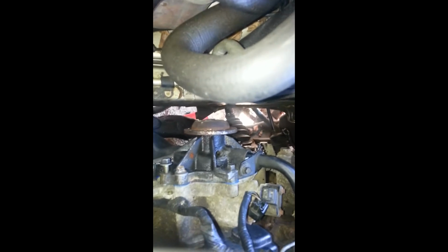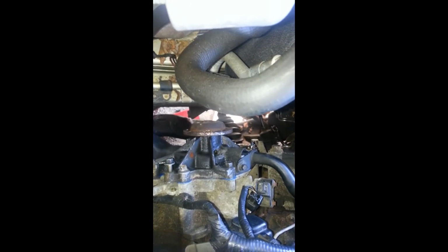Okay, I'm just going through here torquing all these down now, and I'm going 20 foot-pounds or 240 inch-pounds. I'm using my inch-pound. The main reason is my foot-pound doesn't seem to be real accurate when I get down to 20, because it only goes down to 20, so I just prefer to use the inch-pound. But right now I'm just tightening them all to 240 inch-pounds.